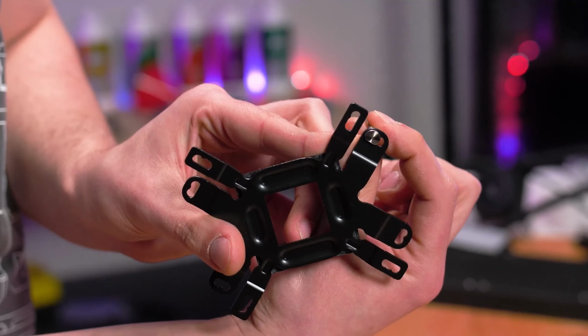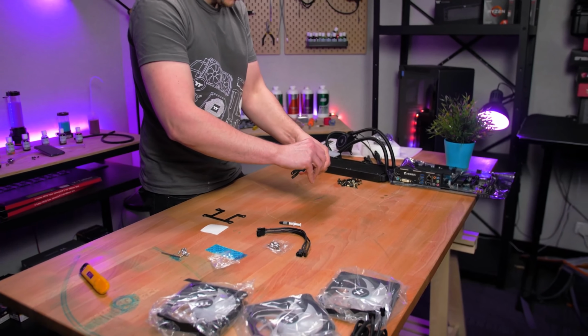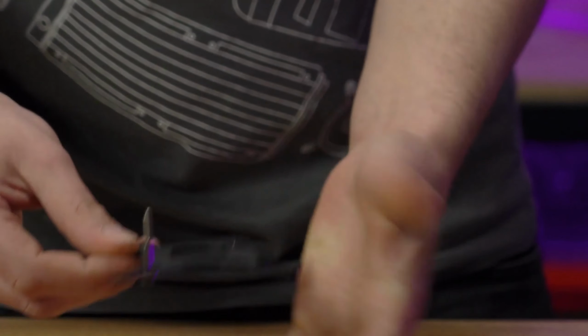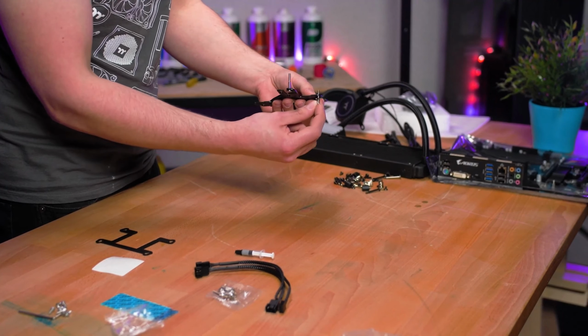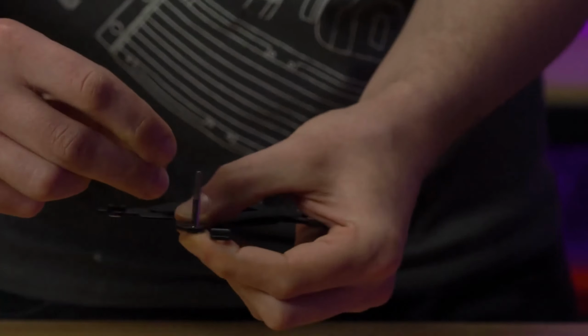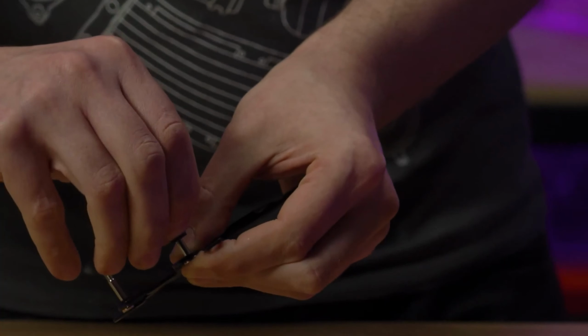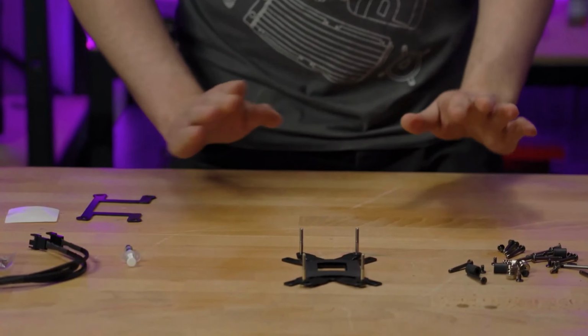The screws have a flat side and a round side to their head, which ensures they stay in place, and it means you can't really install them wrong. Also, ensure to place a washer on the inside of the backplate, as this helps to lock the screw tightly and balances out the offset of the backplate. Now go ahead and install the other screws.